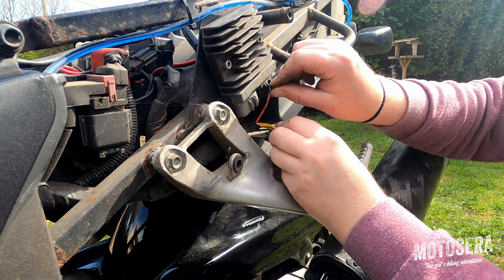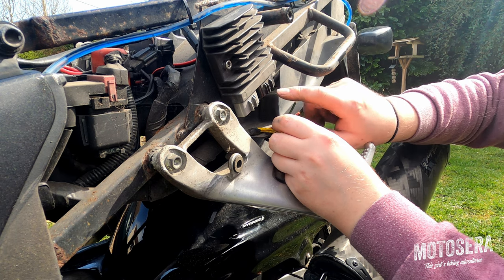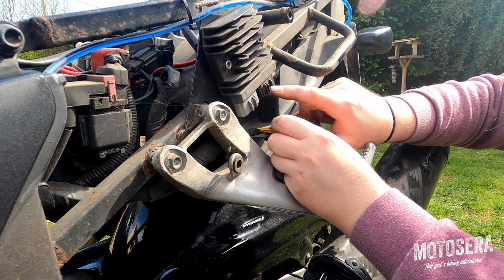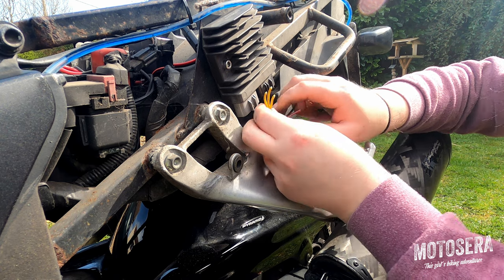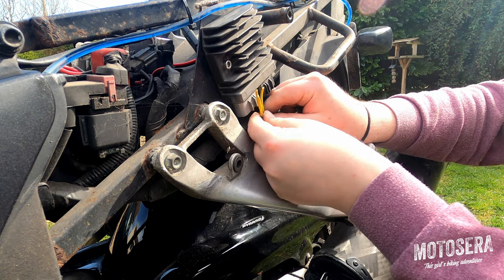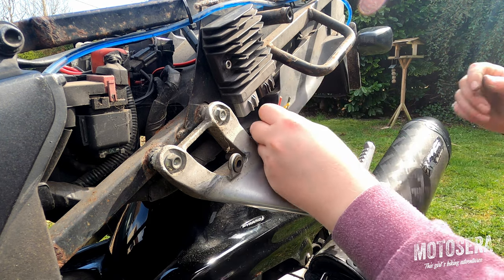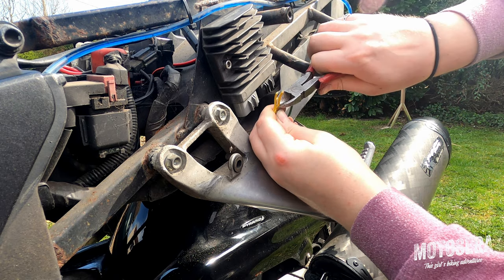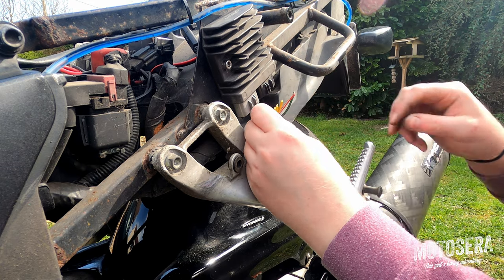So now we've got better access to all the cables. We've got our red and white which is the positive to the battery, and the green which is the negative — they connect to the black connector. There are only two terminals in there. On the gray connector we connect the three phases from the generator or the alternator, and it doesn't matter what order those are connected in. These cables are going to be a little bit too long so I'm going to cut those down. The others are already exactly the right length so I don't need to touch those. Let's get these trimmed down and we'll fit the terminals and then the connectors.